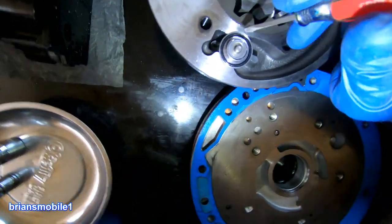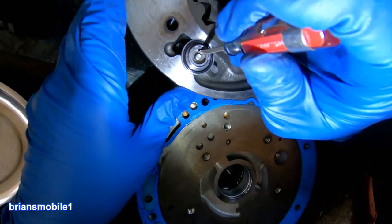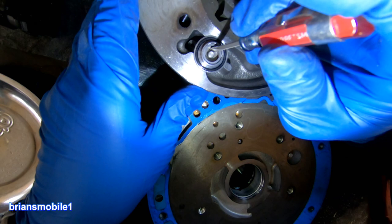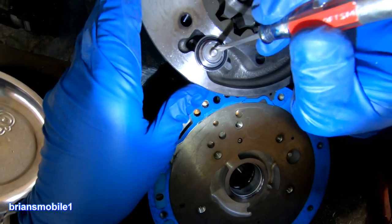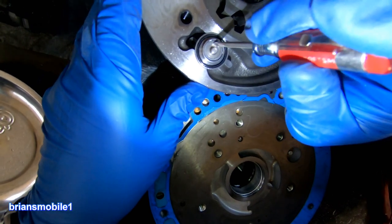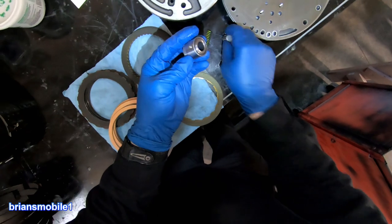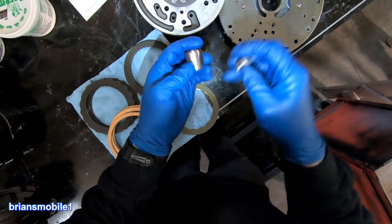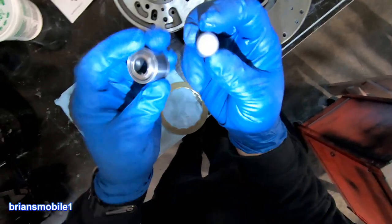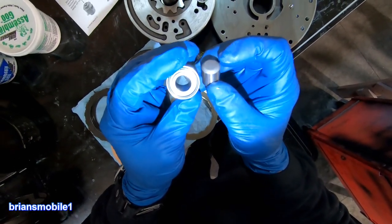What happens with this valve is it'll fail because it gets a little wear edge — you can hear it clicking right there. It shouldn't be hitting anything; it should be sliding right up. But it'll get stuck on that and then you don't have any pressure. We've got a new flow control valve. It doesn't fit in this way, but it fits in this way. The key attribute is that it's rounded on the top so that it can't get stuck.